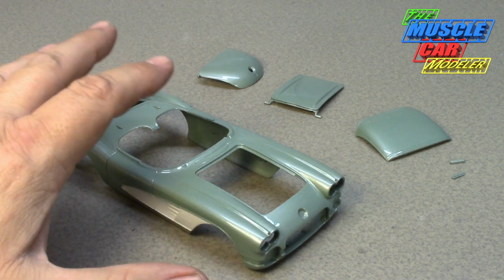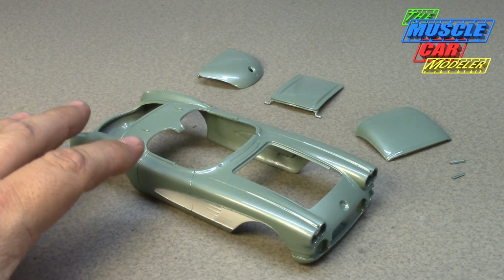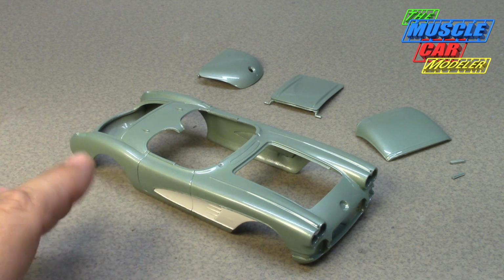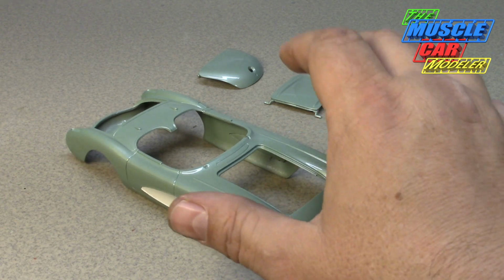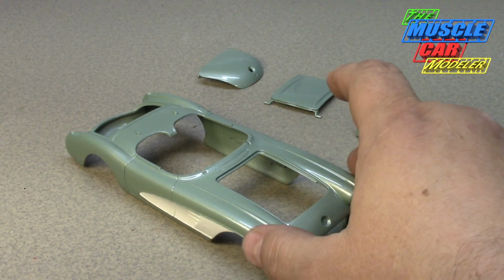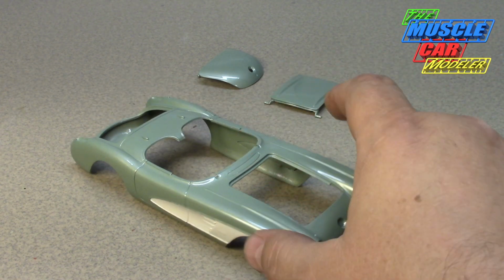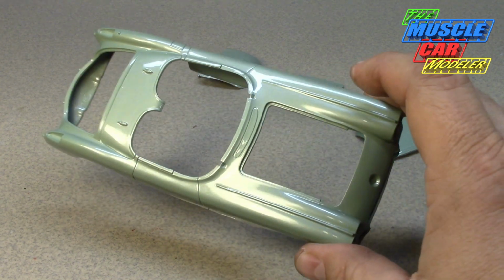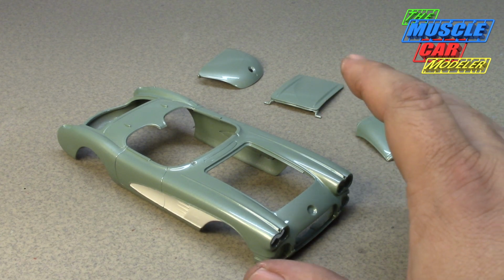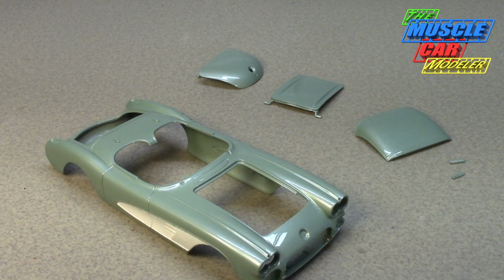I had a few things, and I was doing the foil on it, if you remember or follow that video, and I was cleaning the residue of the foil off with alcohol, and it got into the clear and messed up the clear. And I don't think the clear was actually mixed right by me. It had hardened on this one, but not to the point it's hardened now, because I went to the paint store and bought some more hardener, and I think my hardener was expiring because it was many years old, and it does expire.